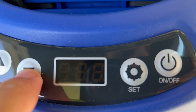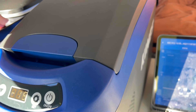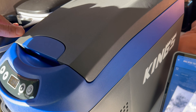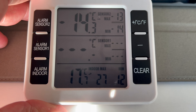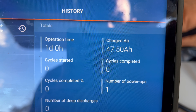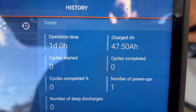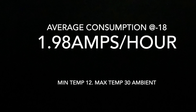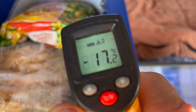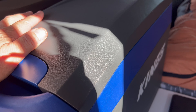Now I've got to load it up for the frozen test. Set to minus 18 — I'll let this get to operating temperature, then I'll start the test. I generally don't use this as a freezer; I'm just doing this test to show you what it uses on freezer mode if you happen to do that. The minimum overnight was 12 degrees and the maximum got to 30; it's currently 28.7 degrees in the vehicle. We've got 47.5 amp hours — this is running on freezer on full power at minus 18 degrees. We're at minus 17 on the thermometer gun. This was done mid-July, so we are in the middle of winter, and it's going to be a different power consumption in summer.